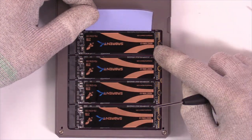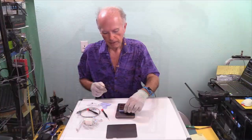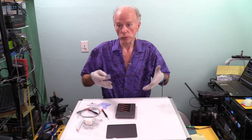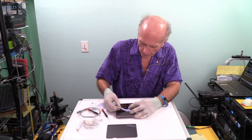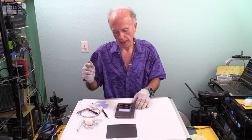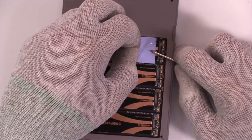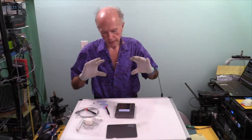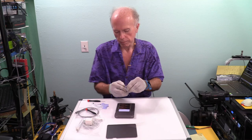We are not taking the labels off these drives — that's a metallic label and that's your choice if you choose to. We test far too many devices to take labels off. None of these installations we show you are permanent; this is strictly to show you how this stuff works. The pads have a little bit of tack to them, a little stickiness. I'm going to position them closer to the connector end. These are the kind of pads made up of squares, and I like a full thermal pad to cover the whole thing because I like even pressure on compression.